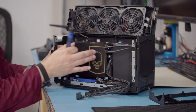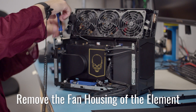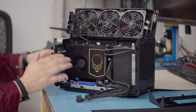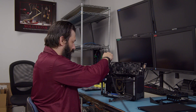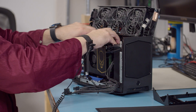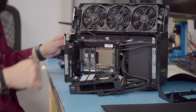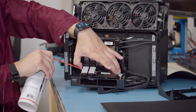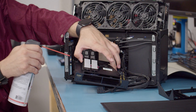Now for the element, you will want to remove this fan housing here for ventilation. Exposing the element, there are two screws at the top that you will want to unscrew. We're going to lift up on this and pull outwards, exposing the insides and the fan housing. We're going to take our canned air and come in from the bottom, trying to blow underneath this panel of thermal pads to get to the fan.